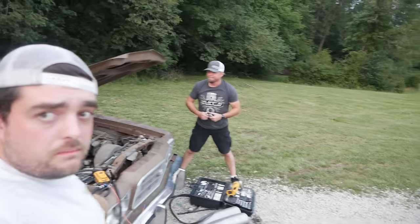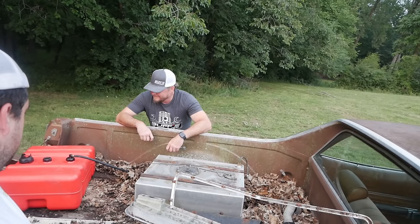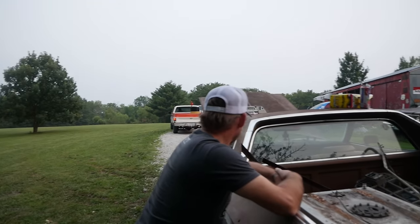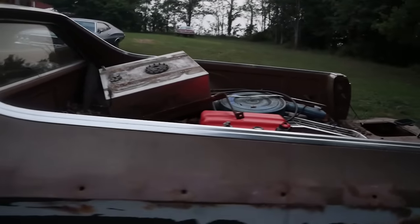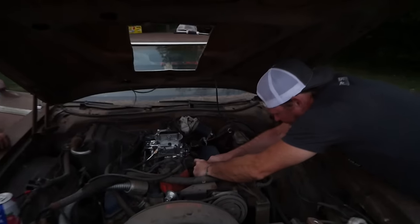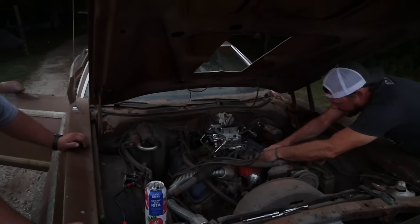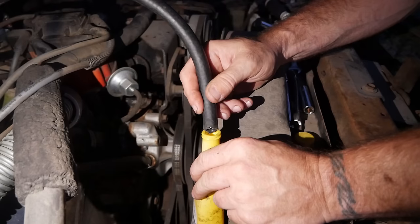We need to make a fuel system and then drive this thing. With our case of motivation, we'll remove the old fuel cell and install a new NHRA fuel cell. Cody has returned. There's a hole — what a stupid spot to cut that. We're losing daylight fast, but we're hooked up in the back. Buff is cutting back the pathetically small 5/16ths fuel line up front — that needs to be changed to 3/8ths immediately. It has 3/8ths from front to back, but even a stock 429 probably needs more fuel than that.